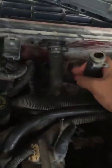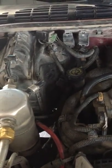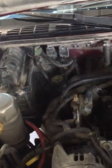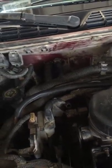Since I'm over here, I'll show you the two tubes you'll need to remove. I actually did these last, so removing them last is fine — it's up to you. That's where your heater core tubing comes out, right back there in those two little slots. Some other videos about different models said the bolts and nuts were extremely hard to get off, but on this one it was extremely easy — it popped right out. That may be different for other makes and models, but not for this 96 Chevy S10.